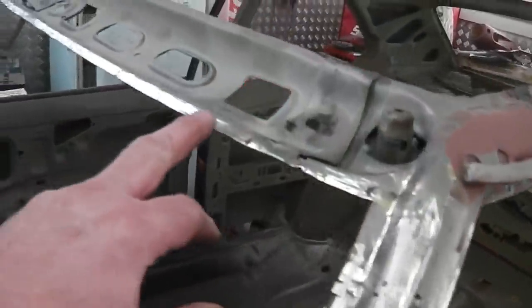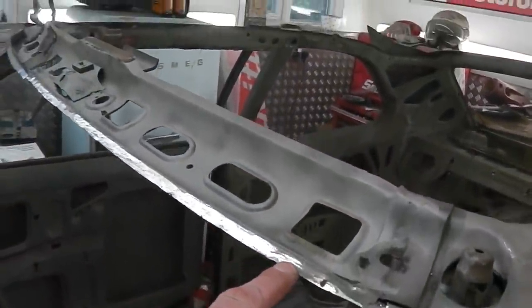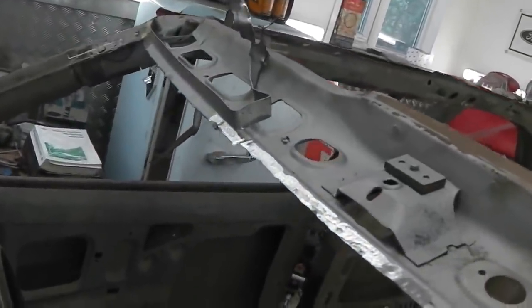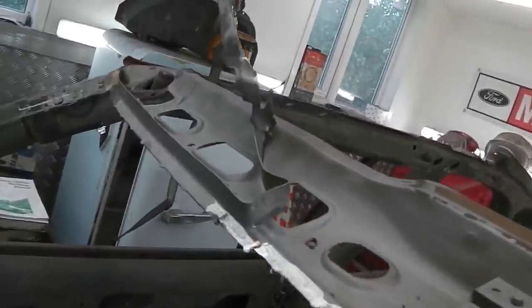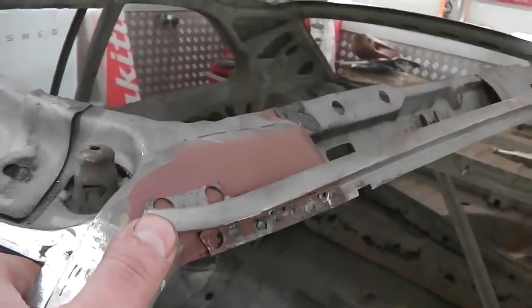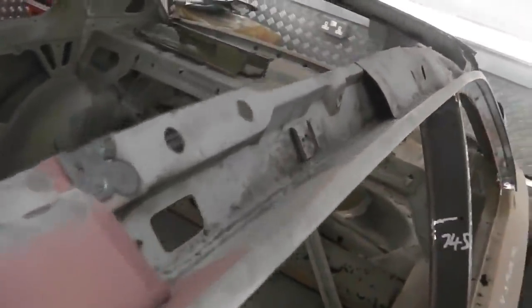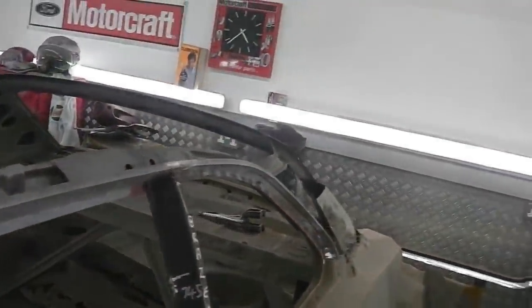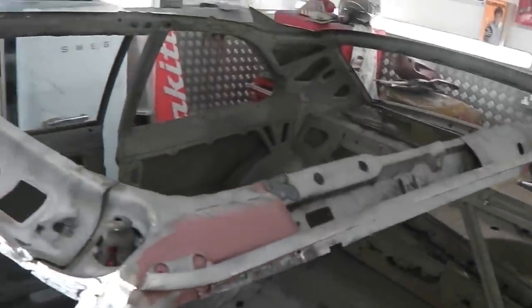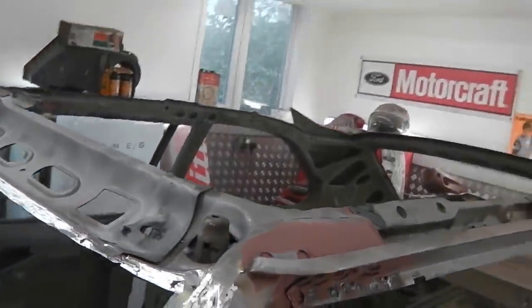So whilst we're doing that, I need a bit of a tidy up again, it soon gets messy, we've said it before. We're now cleaning the receiving edge off this roof structure that's gone on very nicely. So that's just a case of nibbling away at it with a croc sander till you break through. See the remains of the old skin, how we cut that off. Here just needs the gutter channels welding in place and cleaning up some paint down on the rails. Then we've got to unpick the remains of the back roof off, so we've got a complete clear roof structure ready to receive this skin.